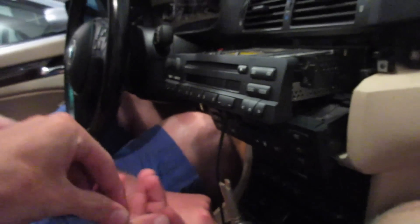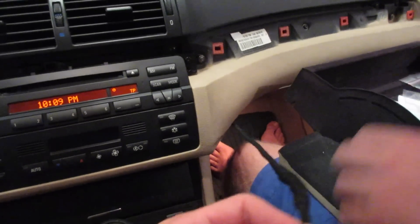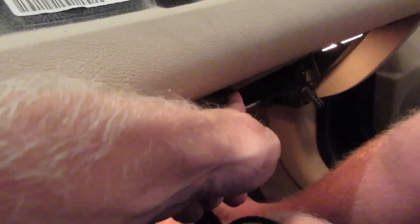So I'm just going to let it fall down like that. Probably a good idea to take whatever stuff you have in there out, and we'll figure out what's connecting it at the bottom. In the footwell, you're going to find four Phillips head screws holding this on the bottom of the glove box. In that center channel is the hinge for it, so just remove the four Phillips and open up the glove box — it'll fall off in your hands. That's going to give you the access you need to remove some of this interior paneling to make room for the cable to come through. The worst part of this job is getting the cable into the glove box area through this piece of the dashboard. With the radio still out and hanging by its wire, and this piece pushed out and also hanging by its wire, you're going to want to reach back there and shove your hand way back up in here. You're actually going to remove about three Phillips screws from the glove box ceiling, just so you can pry it down. Shove the wire through.